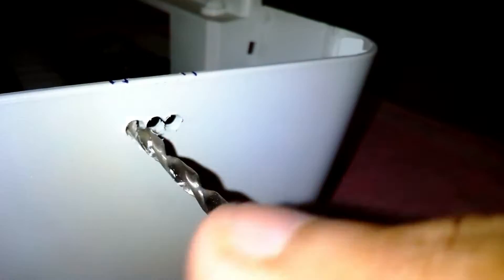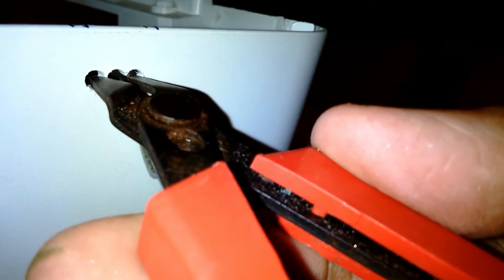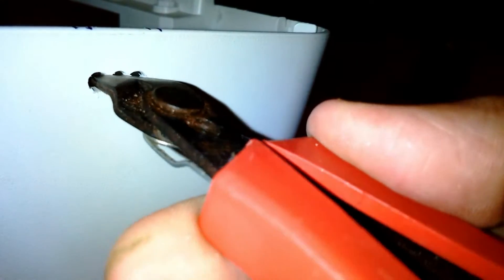You can see I've made the hole. Now I'm going to cut all the holes so they combine together to make a big slot, and I'm going to use sandpaper or a knife to make it smooth. It's almost widened enough now — I'm trimming the edges. After cutting it with a knife and using a little sandpaper, it's ready.